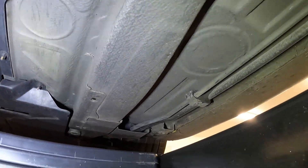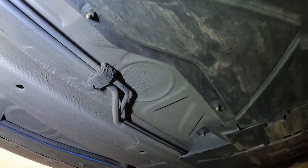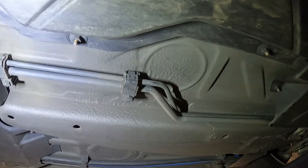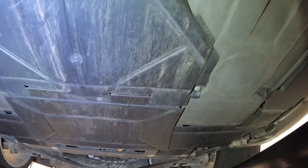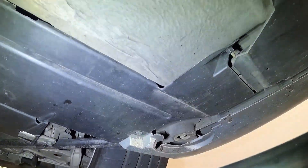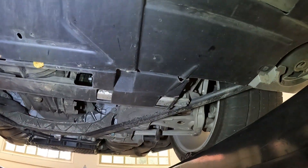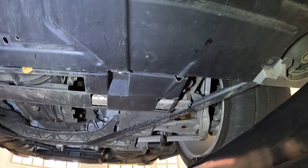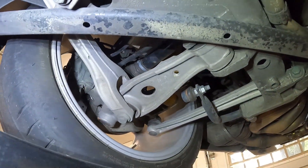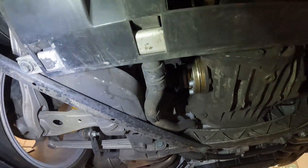They don't have any sort of side panels — I don't know, I haven't been under a new one. Got hoses and pipes running front to back of course, because you've got the battery and cooling components in the front and all the stuff that drives it in the back — fuel line and brake line there. More plastic covers. You can't really see the transmission — it's under there. Another jacking point. A lot of these plastic bits are missing or broken up back here, but I patched them together. Then you get to the rear suspension — it's all aluminum, including the hub carrier. Same aluminum brakes, and there's a big aluminum subframe here.